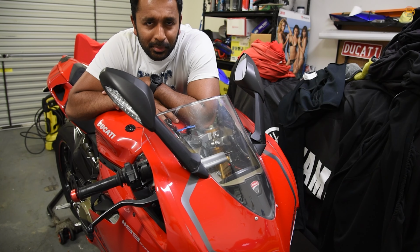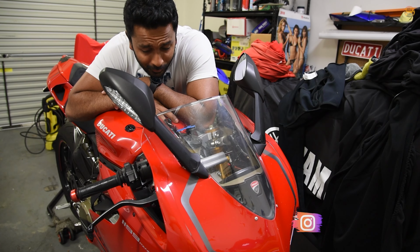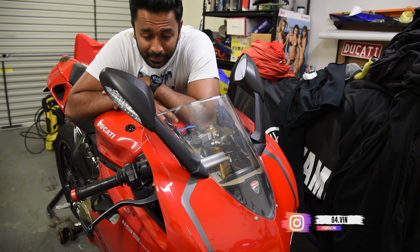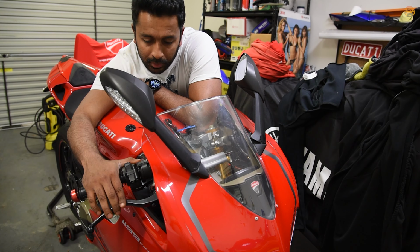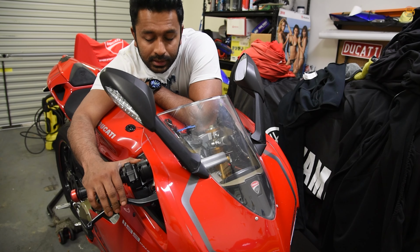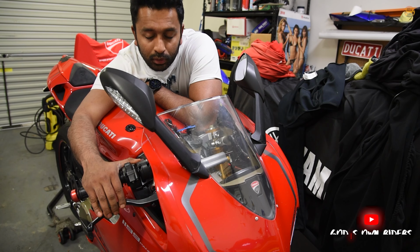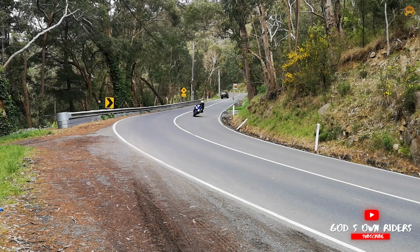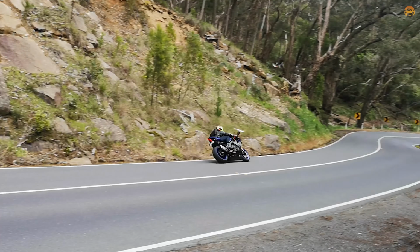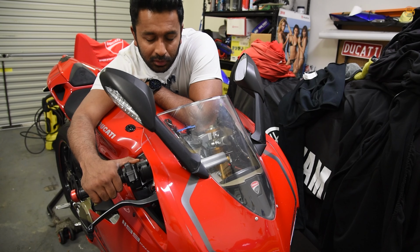This video is going to be about some maintenance work. I'm working on my red Ducati. I've got some issues with braking. Lately I've been experiencing issues with the lever. The braking bite has reduced a little bit and I feel like I need to pull the lever a lot harder to get braking. It feels like it's a master cylinder issue. My R1, which has no Brembo brakes and stuff, brakes a lot better than this, so there's definitely something wrong.